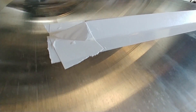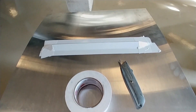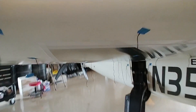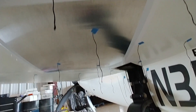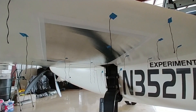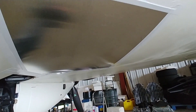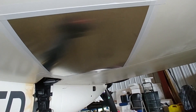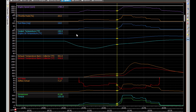Welcome back. I've got these aluminum sheets that are 24 inches square with L-channel on the backside to add support. I've taped it into place to cover the wheel well, lined up with the leading edge of the wing so the curvature of the wing follows the curvature of the aluminum. That way it's only curving in one direction, so it's not prone to pop off. I need to test it running down the runway at different speeds to see if it shows any sign of movement.